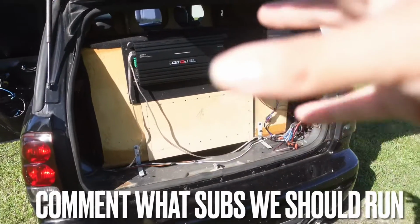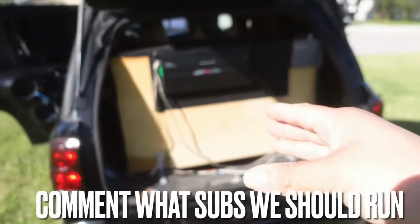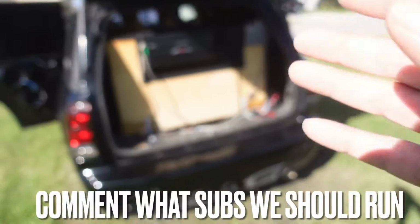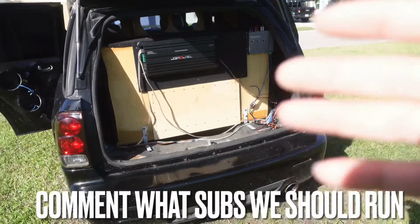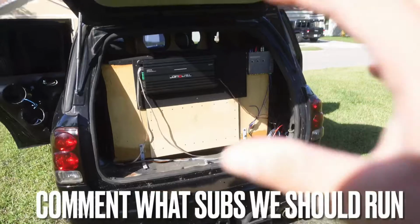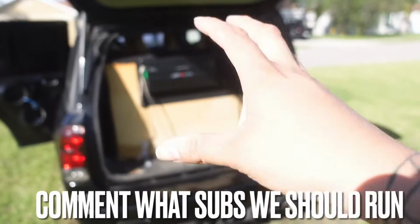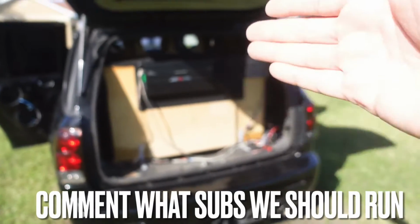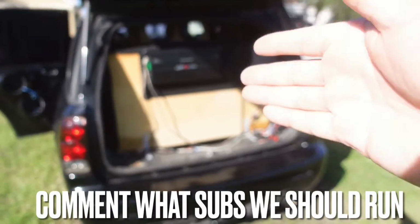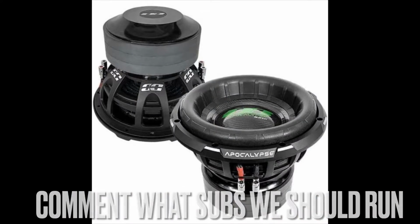I pretty much got like 12 cubes that I can squeeze airspace into this guy and put 412s probably on a 12K. Maybe 612s on a 12K. So pretty much 412s, 612s I can fit, depending on placement of the magnet. I'll figure that out. But I got 12 cubes to play with. Drop down in the comments what subs we should go with on the new Trailblazer build. Sundowns or Deaf Bonce, I think that's what it's called.